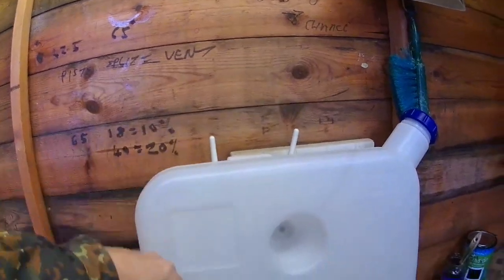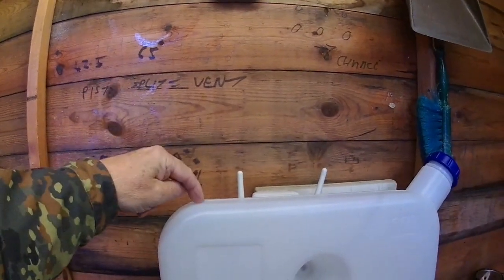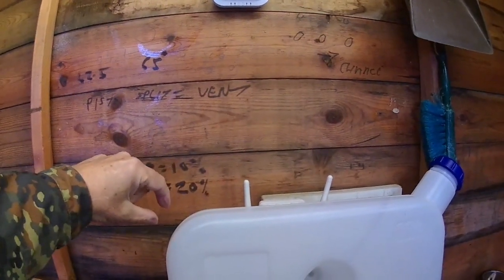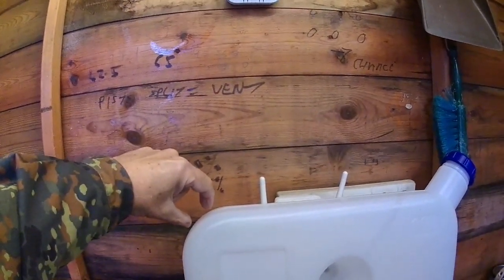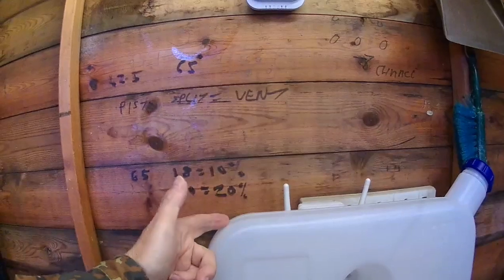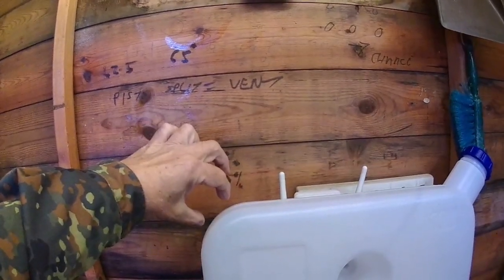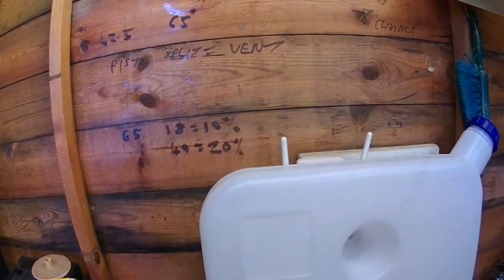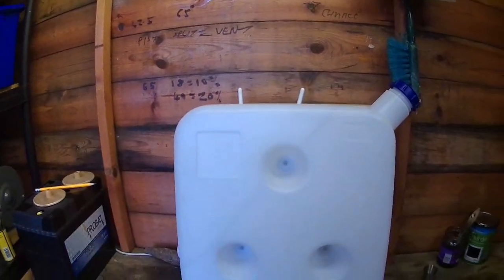You've got a metal pipe running down here picking the fuel up. The rubber pipe is about that long, and it goes from your pickup pipe to the plastic pipe, which is a very springy, sturdy plastic. So you've got a very small rubber joint here, and if this perishes, air will get into the pipe, but you get very little fuel leakage. That white plastic pipe goes through a hole in your floor, and all the other rubber fittings are underneath your van, so any leaks will be on the floor.